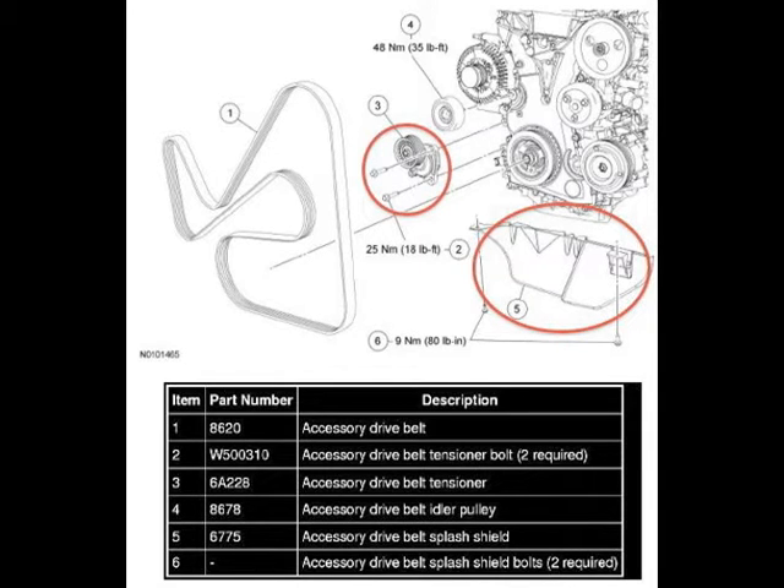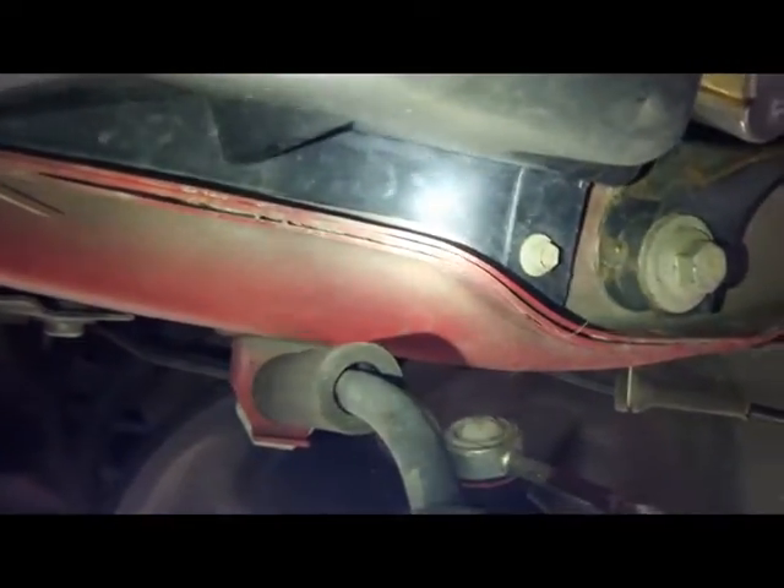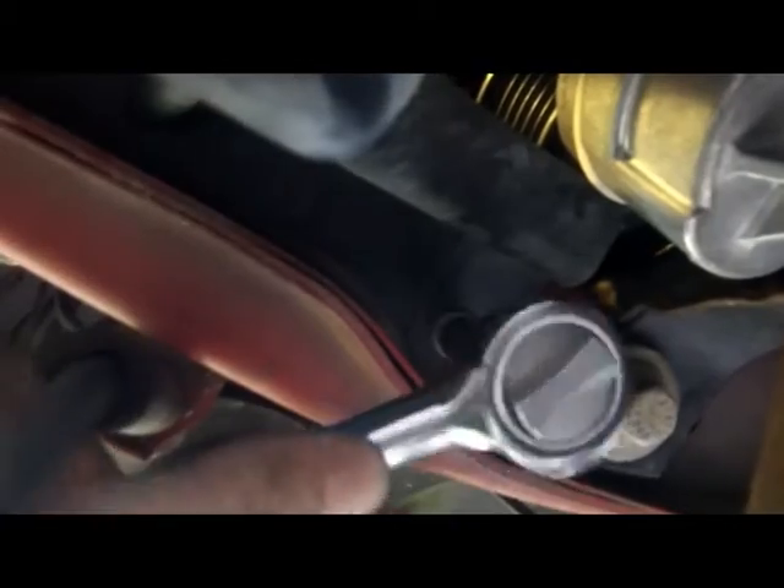Let's take a look at a diagram to see what we're looking at. You can see the pattern on the serpentine belt and the wheels involved, and the splash guard on the right is what we're taking off. There are two bolts holding in that splash guard — this is just a plastic guard between the serpentine belt and the wheel. I think these are also 10mm bolts — everything is going to be 10, 13, or 8; there's not much variety.